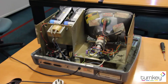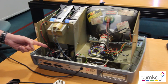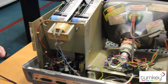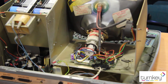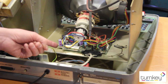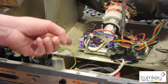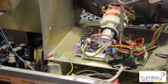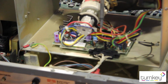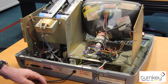Can you tell me what the screen resolution was? Round the back we have a power supply, and a transformer here which I'm certain was an aftermarket addition for the UK market, as these machines were shipped across from the States. We've got a video card driving a traditional CRT monitor built into it. It was this particular card that you had to get out without electrocuting yourself and sort the dry joints that caused video problems. This one's got a sticker on it suggesting that in May 1993 it was good — it's not been PAT tested since.